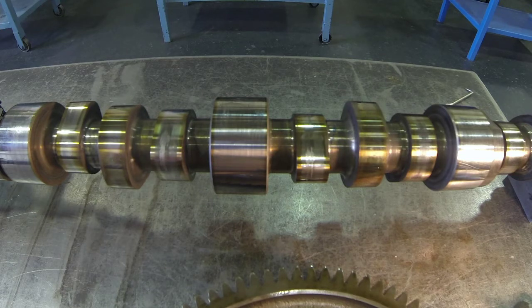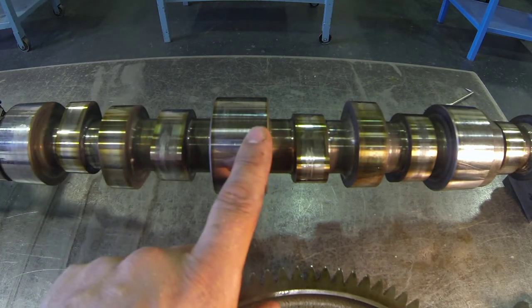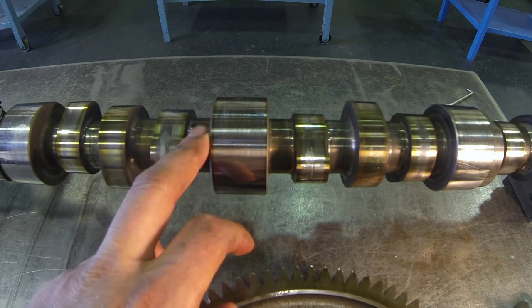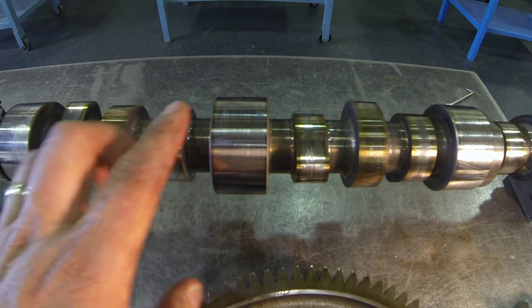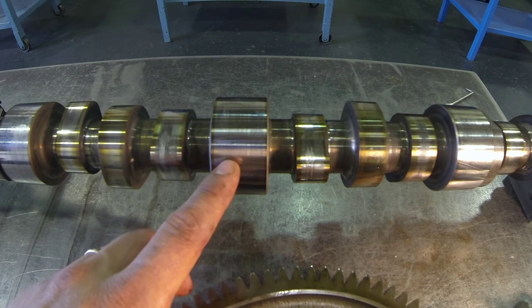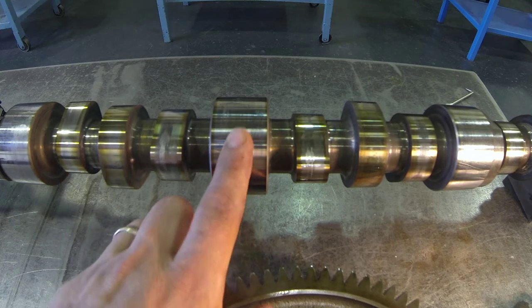There are times where you will see a lack of lube or a starving of engine oil at the contact surfaces of the bearings. When that's true, the bearing surface itself also starts to turn blue. When that happens, you know you're no longer in normal operating condition but instead running in an overheat condition likely caused by a lack of lubrication — either a lack of oil in the engine, or a starved component where contamination has blocked a passageway in the head or block, preventing oil from reaching the bearing surface.